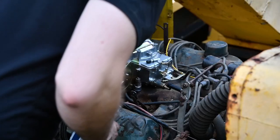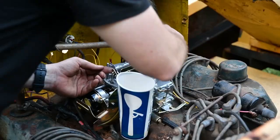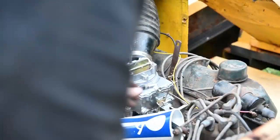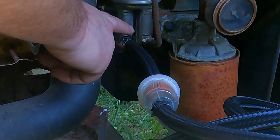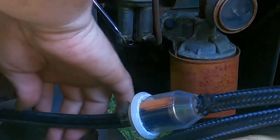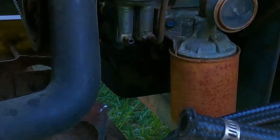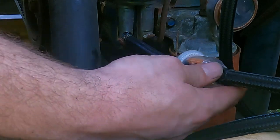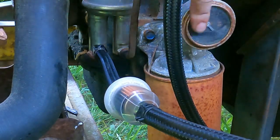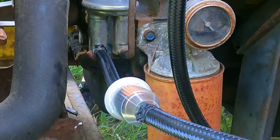Spark plugs changed. We're gonna pour a little bit of fuel into the bowl and then hook the battery up to see if my ignition system works. There we go — the primaries are shooting some fuel, so that should work. Set this cup up to try and catch all the fuel slurry in the line. I think I want to try and clean out the fuel pump — it had all that gunk in it. I'm going to take this line loose and spray some brake clean down through and see if it'll clear some of that out.